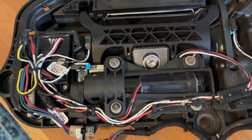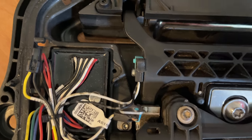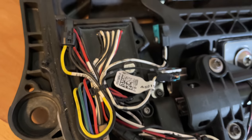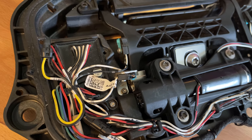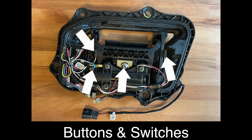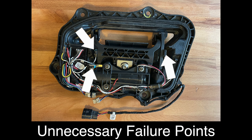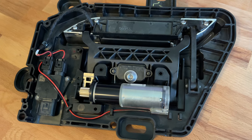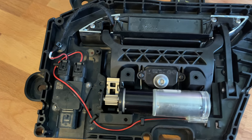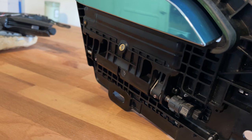The early ones had lots of problems with failures. It was a design with a lot of moving parts and a lot of failure points. To be fair, if you had asked me to design this door handle to do this thing, I would have probably designed it pretty much the same way. I am a mechanical engineer, and while I interface with electrons when needed, I prefer to do so with physical buttons and switches. It satisfies my mechanical brain, but other engineers will sometimes call this an unnecessary failure point. The new design has no moving electrical parts and almost no wires. It uses magnetic fields and a relatively new communications protocol called SENT that you're going to start seeing a lot on cars — but more on that later.